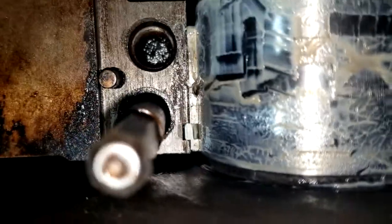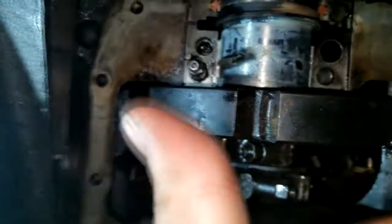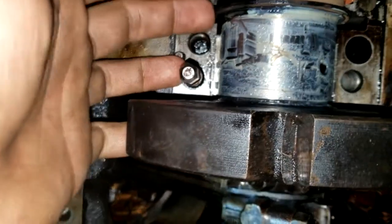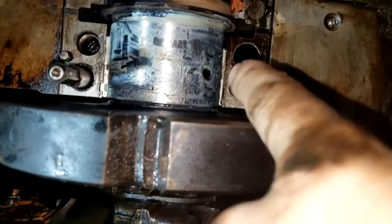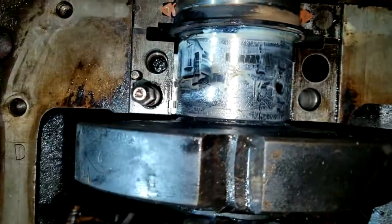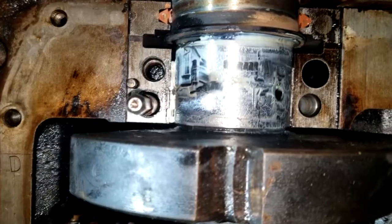See if I run into any more bullshit, which I know is going to happen. That stupid little thing didn't want to go in. But I finally got it, and it's nice and centered and flush. The crankshaft was just maybe like a tenth of a thousandth over to the left. Luckily, I got this nice little leverage hole. I was able to push it over this way. Slid in fine this way when I tested it. But since you got that little tab there, you can't slide it in that way. So, of course, the crankshaft would only sit in the direction where it's preventing me from getting the thing in. After many a days and weeks and many regrettable life choices, the bearings are finally in.